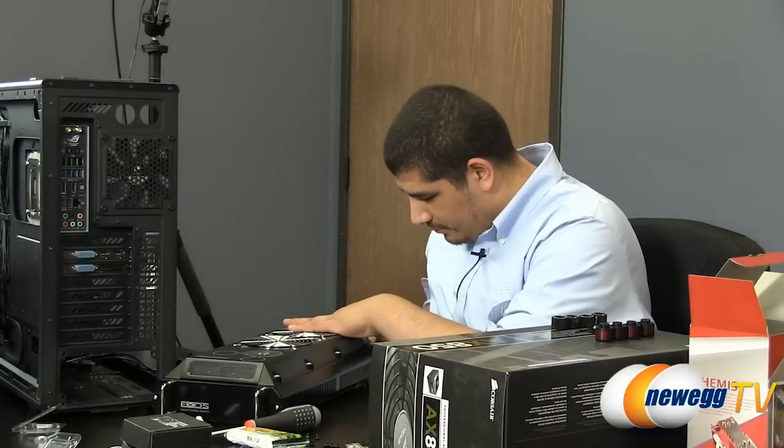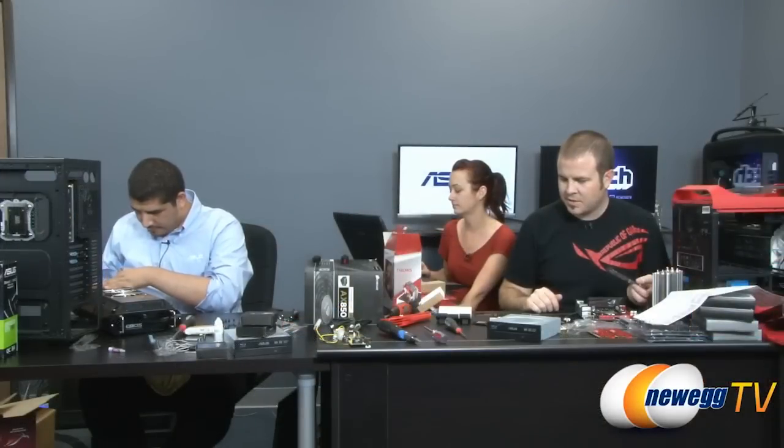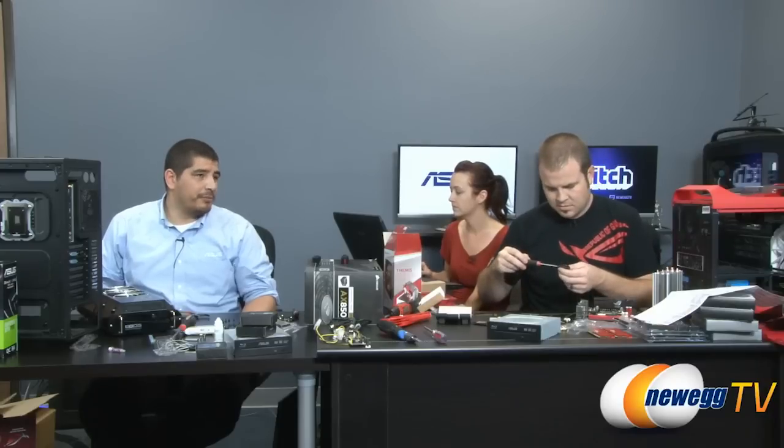All right, question for Paul. Should I get a USB wireless adapter or a PCI wireless adapter? I don't have Ethernet and need a wireless adapter. So what do you got, like an Ultrabook? If it's an Ultrabook or something like that, then USB for sure. They must have a desktop if they're asking about PCI. The Asus PCI 802.11ac, if they want to go really high performance, but we have all kinds of solutions. For the money, the USB N53 is less than $25, and that's dual band, 2.4 and 5 gigahertz. It's a very good performance-based wireless solution. If you want even better performance, you could go with some of the newer ones with 802.11ac. But keep in mind, to get the best benefit from AC, you're going to need an AC-enabled router as well.